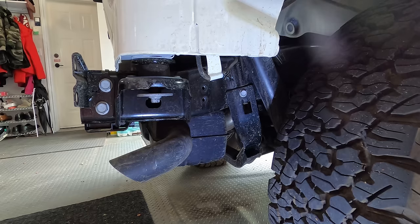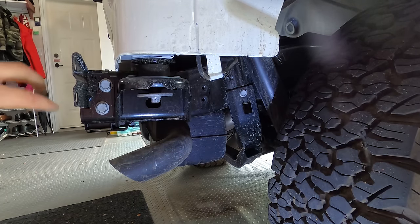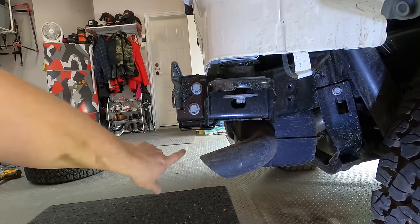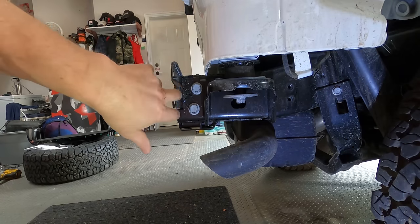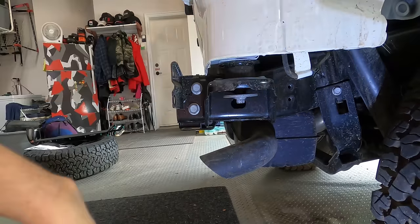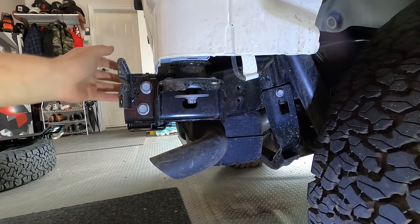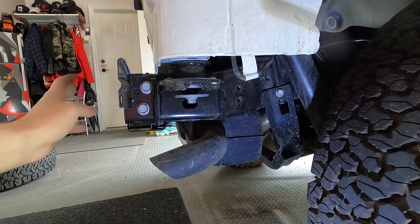Getting the factory bumper off isn't too difficult. There's a pair of bolts right here and under the bumper there is a pair of nuts that need to come off — two studs right here — and then a pair of bolts underneath, with two more on each side. You can get to these by removing three bolts that take off the plastic frame or mud guard. Once you take those off you can get access to these two. I had to take this bracket off, but there was no way to get access to these huge bolts until I took the bumper off.